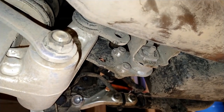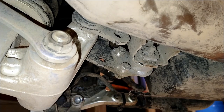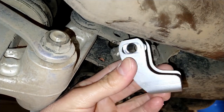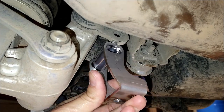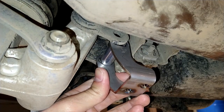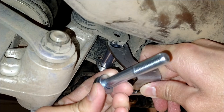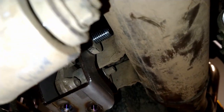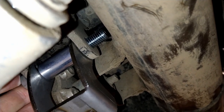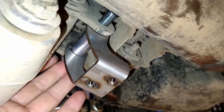We're working from the right side of the bike here. One thing I kind of missed the first time I watched the assembly video is that you actually need two washers for this part. We're going to do one on the bolt. This piece gets installed with the toe of the boot, if you will, facing forward. It just slips up in there like that with the sleeve in place. Since I don't have a center stand — if you do, the configuration is a little bit different. Then I'm going to take my bolt with the washer on it and slip it in from the shifter side. It does get a little close to the exhaust, the catalytic converter, but with that washer in there it's spaced out a little bit better.